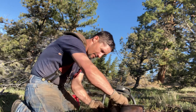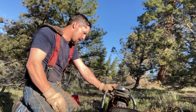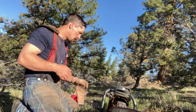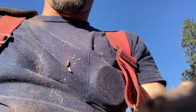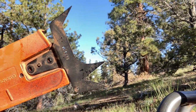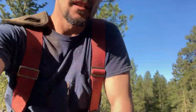Getting the divider and the X-Torqs from stock really helps these things idle. This saw idled pretty good already, but with this setup it just idles that much better — which is kind of nice. I also put on West Coast dogs — the three-point West Coast dogs — and I really like them. They're excellent, way better than what Husky runs from stock.